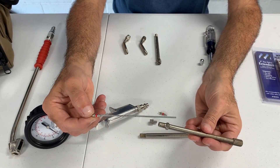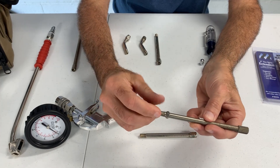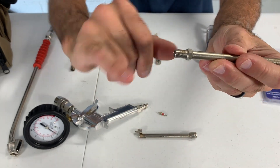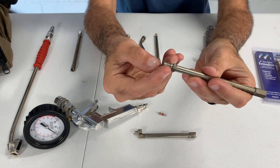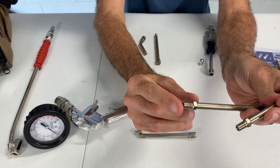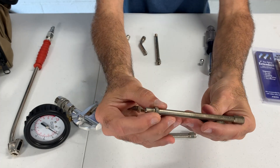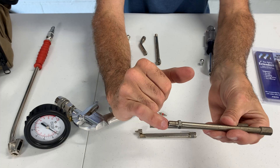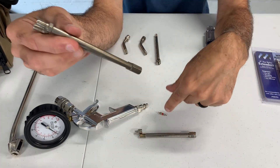What I wanted to show you is the reason why this one failed. The valve stem right here sticks out ever so slightly — probably like two millimeters — and you can push it in. The other one is flush with the top. Because this one sticks out, I'm not sure, maybe the cap bumps it every once in a while. I always had one of the inner duallys lose 5, 10, 15 pounds of air when it would sit for a week — that shouldn't happen. I thought maybe that valve was damaged and not seating all the way, and that's why I bought the new extensions thinking I was solving a problem.